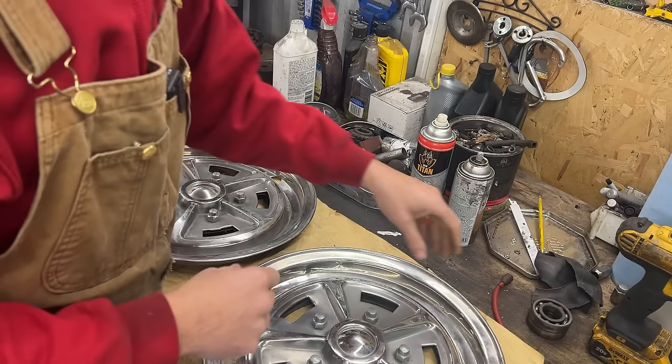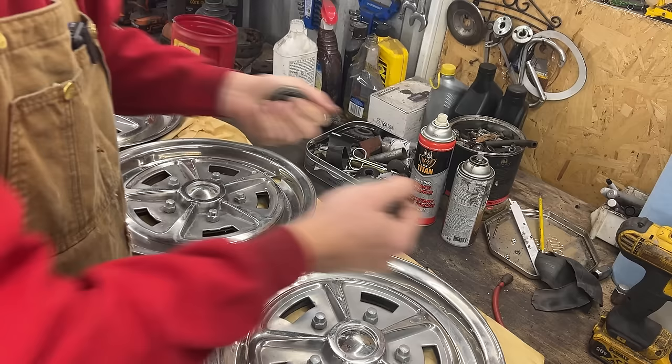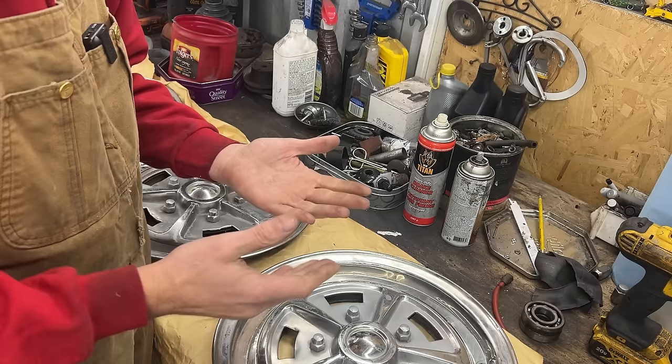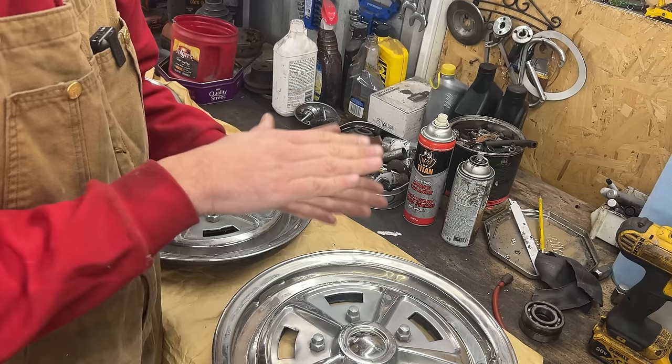The top is always flat, but if we put a flat wheel at the bottom too, and without much pressure, so we don't stretch the material, we just make them barely touch, with enough wheeling, the dents disappear. Because what happens with dents, they're not just metal that is bent, but the metal also stretches. So it needs to shrink. You can't just hammer it back in and expect to get rid of the dent. You actually need to shrink the material. And that's what the English wheel does. With enough passes, if there's not too much pressure to stretch the material, it actually shrinks it.